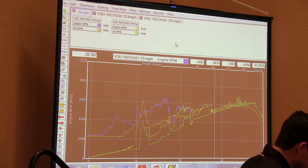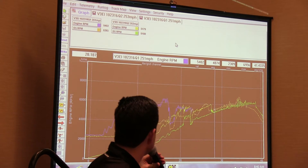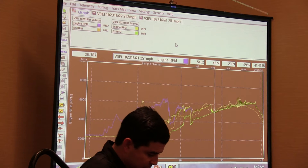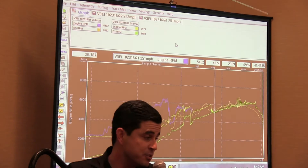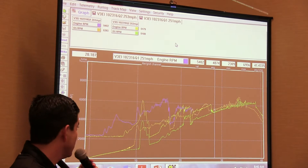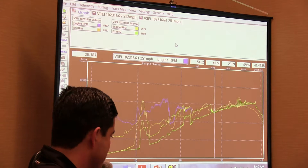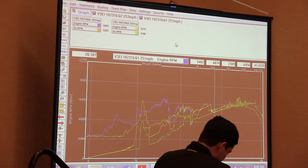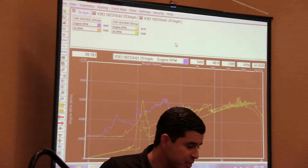There are so many variables in a land speed car, but the difference is — like in a super comp car, in a bracket car where consistency matters — you have to hit your number. You can make sure your throttle stops are activating where you want them to operate. This is a great tool for that. Any fuel system changes, you can look at the difference in air-fuel by overlaying. If you're changing main jets or anything like that, you can overlay all your EGTs from run to run.